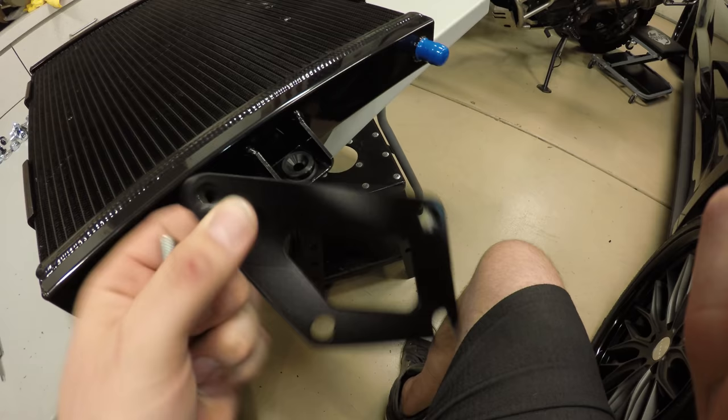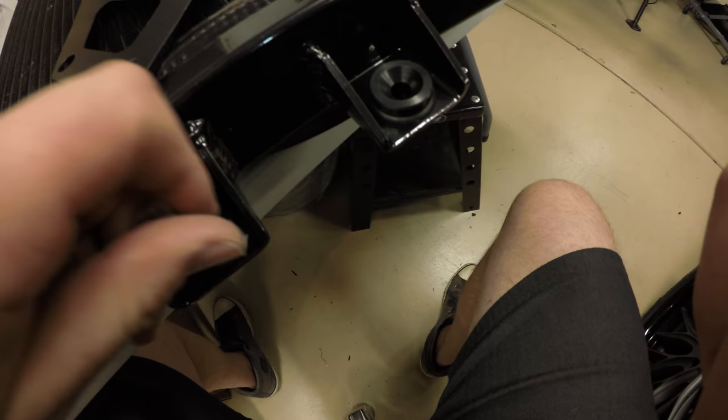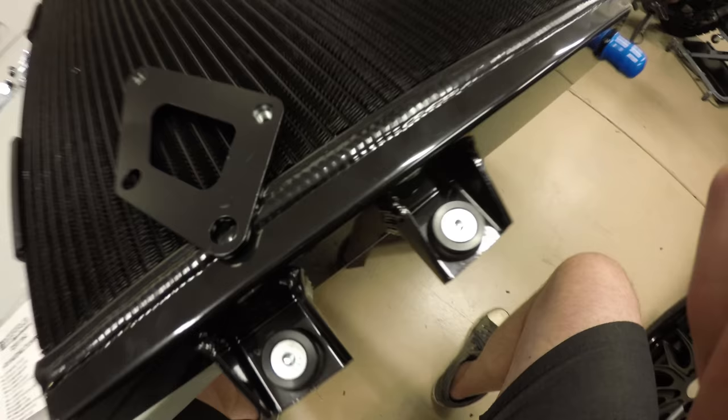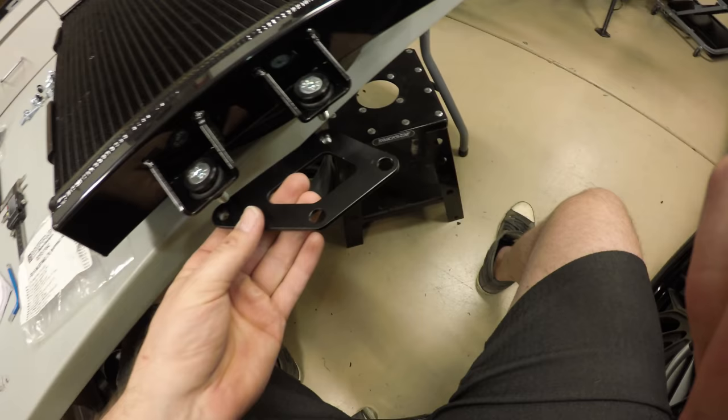You're going to find your 2011-2015 Mustang LTE shipping bolt bag. There's going to be 4 8x35mm flathead bolts, and that's what these guys are. They go into these metal spuds. God, couldn't think of the name. And it's basically only one way it can go on.